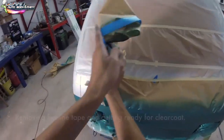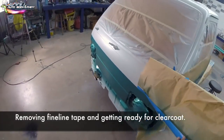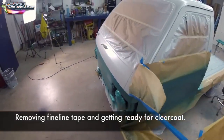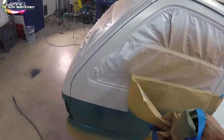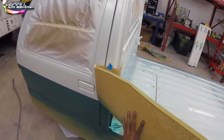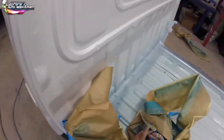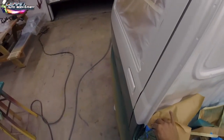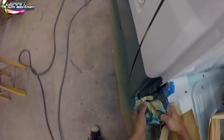Thank you for watching — Tony here from learnautobodyandpaint.com. What we're doing here is removing the masking tape and the fine line tape, which is the darker blue skinny tape about one-eighth inch wide. They also make a quarter-inch wide version. Fine line tape is used for making graphics, pin striping, flames, and separating colors on multi-tone paint jobs.